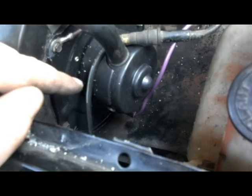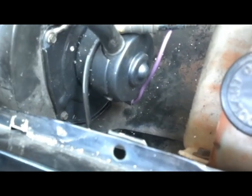I moved my ground wire from way down there to right here — that's just for me since it's my vehicle, so it's easier next time. If you've ever messed around with electrical stuff, painted surfaces don't make a good ground, so I took my knife and scraped off all the paint right here. I didn't put the bottom bolt back in either because it was a pain — I'm a diesel mechanic and all my tools are at work. That bottom one is a booger if you don't have the right wobble or a cordless ratchet, so I just left it out — it isn't going to hurt anything.